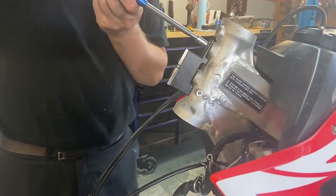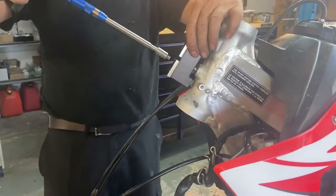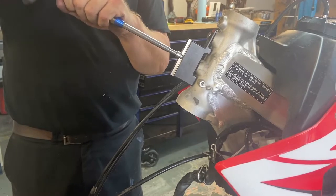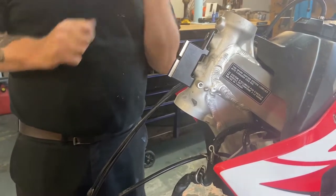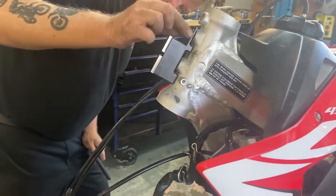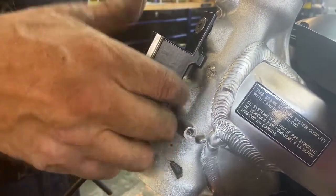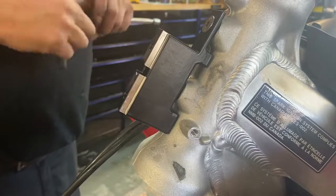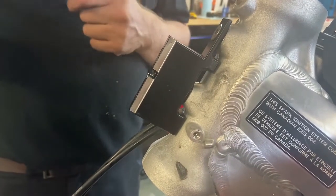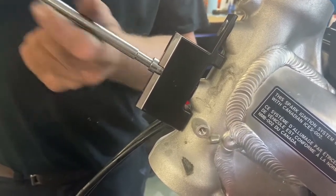This is the very first initial fit, so these holes aren't exact — unfortunately, they should be. You just got to get them going in loosely and then it'll go in and sit. I will admit, I held this up to the bike before and I had a concern: it's really hard to see in the picture, but there's actually a bit of a gap with this bottomed out here and this bottomed out here. We have a bit of a gap between the mount and the boss for the bolts. So I'm going to give it a quick tighten and see if it's going to get rid of that gap itself.